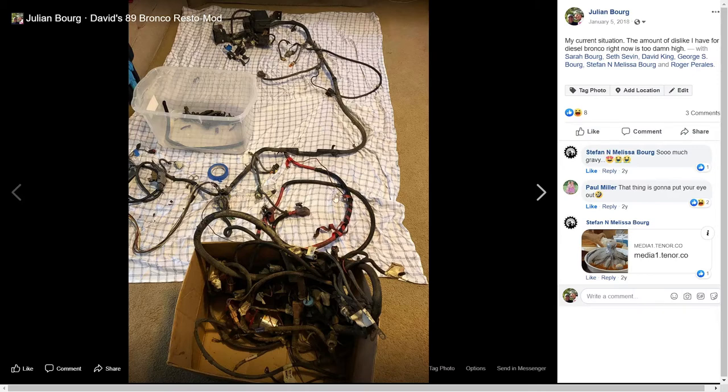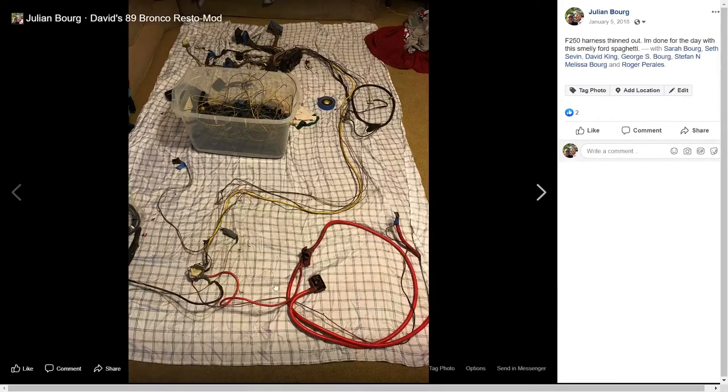You can see the power cables for the F-250 here. I've got the F-250's engine bay harness laid out and I've de-loomed it to expose all of the wiring. I'm going through with some Windex, cleaning the wires, looking for breaks, and deciding what stays. You can see this bin is full of wires I've cut out to wildly simplify things — because since we're keeping the Bronco's engine bay and body harness, all we need from the F-250's harness is the engine control stuff.